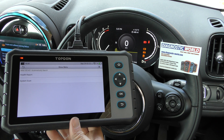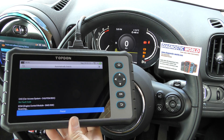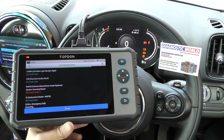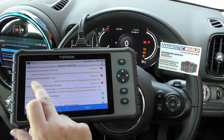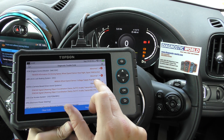I'm going to give it 10 seconds. Yeah, here we go. So it's scanning through the systems of the vehicle and it's found in the ABS system, which is what we were looking for — a fault: ABS sensor, wheel speed sensor, rear right.